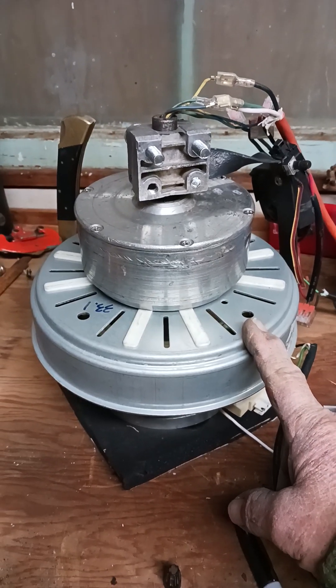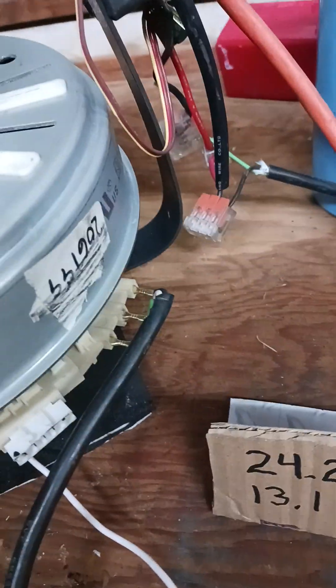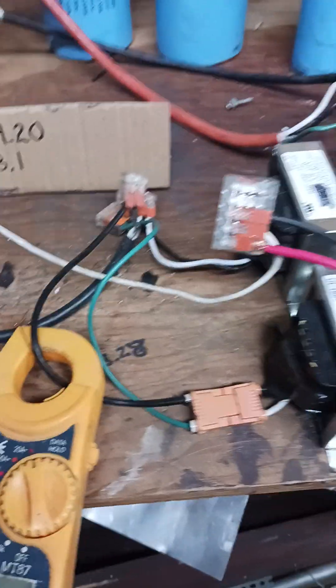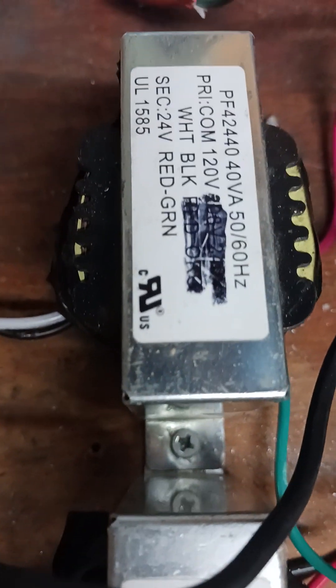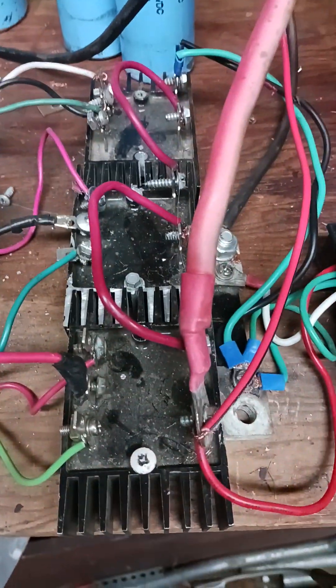...Samsung washing machine motor, 240 volt three phase. You can see the output right down there coming out on that black line. It comes into a junction of some wires which goes into two transformers, tied to the primary side. It puts out low voltage because I've got high voltage coming out of that, and it drops into these two rectifiers right here — three phase rectifiers for those two transformers.